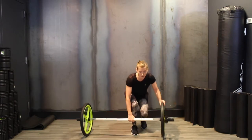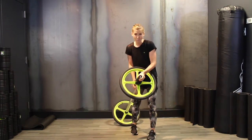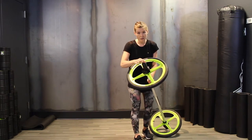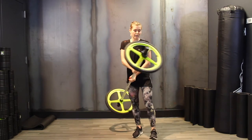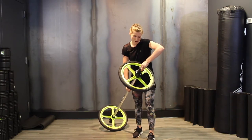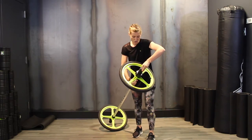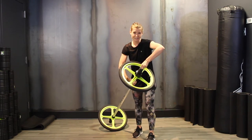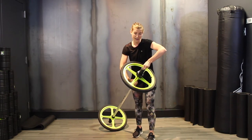Another really awesome tip for taking care of your axle is that you can pop the clips off — or the little toppers off. This side's already done, and here you're going to see this little nut, and you just want to make sure that whenever you're feeling like something's loose or maybe not working quite as well, check that and make sure that it's tightened enough by hand.